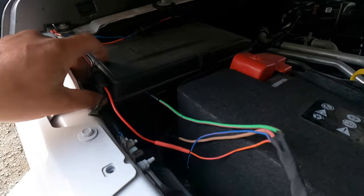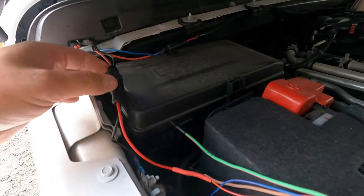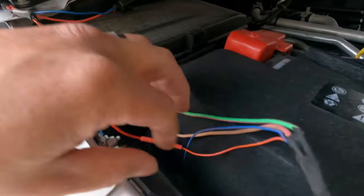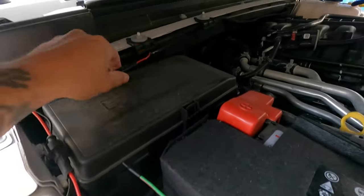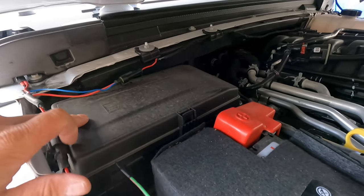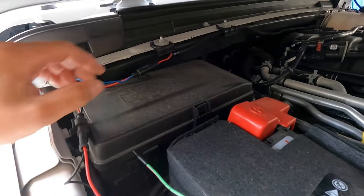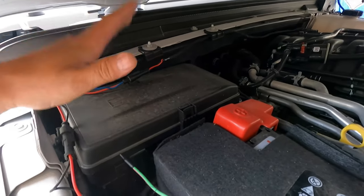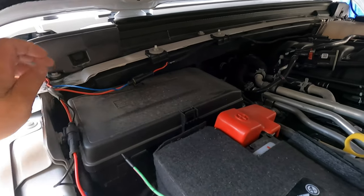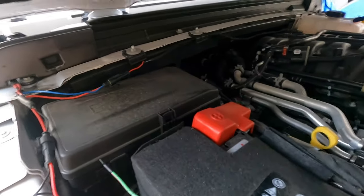And as you saw, I was starting to make some waterproof connections. I have these connectors. This one here goes straight off the main power. This one here goes over to the driver's side. So if I have to replace any of these lights, I unplug this connector or that connector, whichever one's needed. I can take out the light, reconnect it, and plug it back in, and away we go.